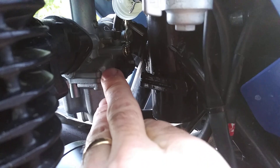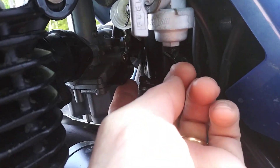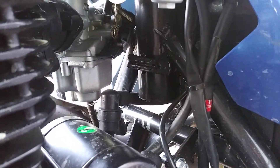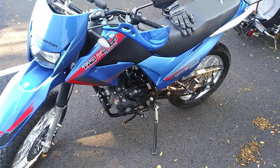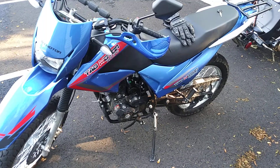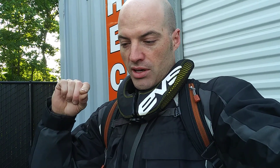So here is your choke right here. Notice I have it in the middle position. This is cold start and drive it in the middle position. I just drove it to work today and had absolutely no sputtering, was able to give it full throttle in fifth gear going uphill. Just drive it in the middle choke position.